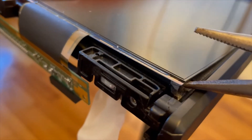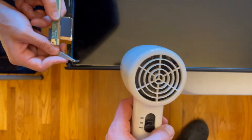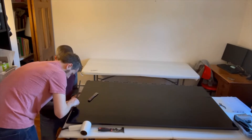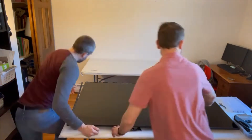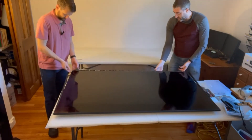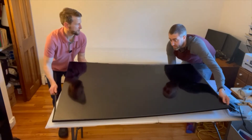The LCD is still held on with a really strong adhesive. To remove it, we apply a little bit of heat to loosen up the adhesive, then get underneath and pry it up. We did end up breaking some more of the LCD doing this, so what worked much better was just to cut it. The molding — the frame around the edge of the TV — holds the LCD in place and starts to come apart nicely. We do that on both sides and the LCD starts to come up. It's quite flexible, especially considering it contains multiple layers of glass — it behaves a bit like flexible plastic, but obviously it is fragile.